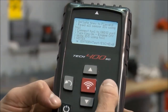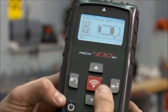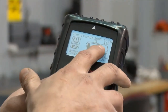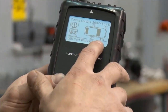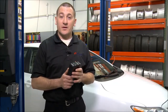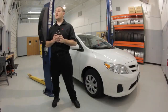We're now ready to start the test before touch. We start at the left front tire, then it automatically scrolls to the right front, then right rear, then left rear. The left front tire is showing 32 PSI along with the sensor ID. The right front tire shows an X, meaning the sensor is mechanically broken or electronically non-functional. Now that I know the right front sensor is faulty, I'll get the vehicle on the lift, remove the faulty sensor, program an EZ sensor, install the tire back, do a relearn procedure, and the customer will drive away with a properly serviced TPMS system.